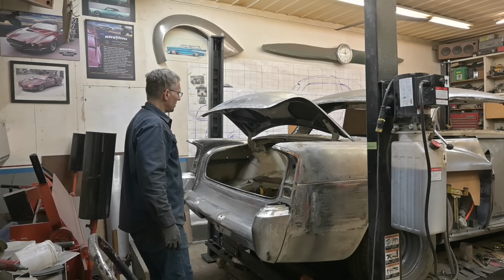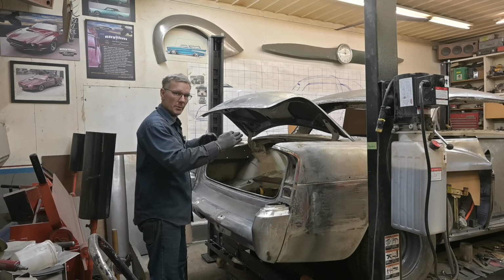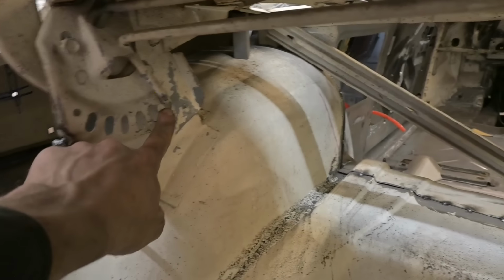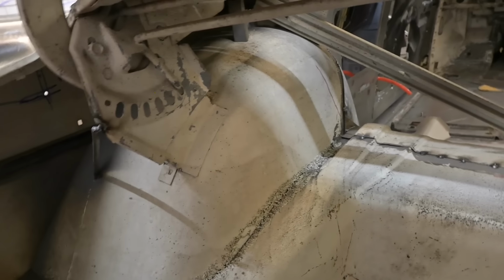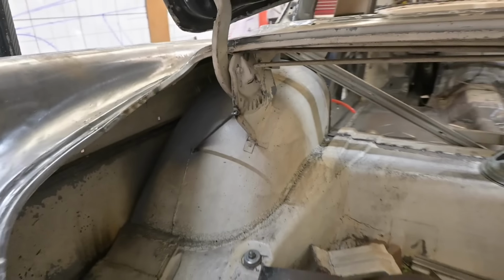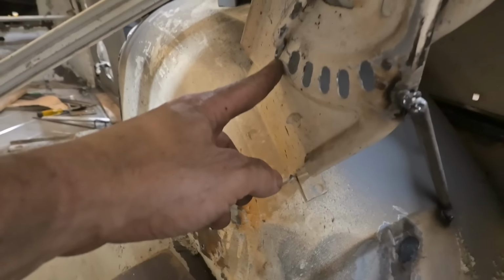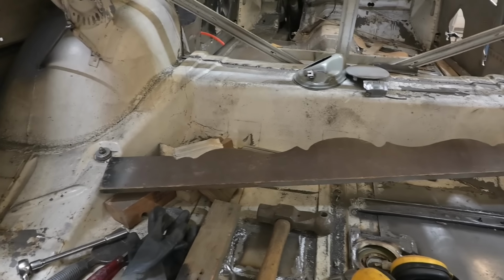It's climbing on its own. I re-drilled new holes for the torsion bars, moved them ahead a little bit more to reduce the force on this. You can see I added one more hole back there. They had provision for tension all the way back to this hole. Like that would have been insane. You could have built a trebuchet or a catapult out of this thing. So we might move this hole this way a little bit. I don't think so. It's feeling good. Once we lubricate everything, then we'll know what to do.